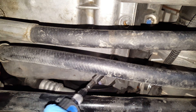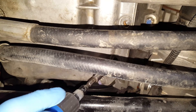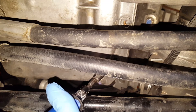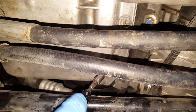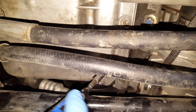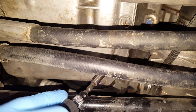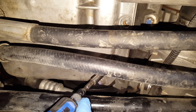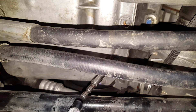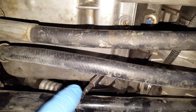We'll see if it's gonna work or if I have to drill it more. Just keep turning. You gotta go really easy — don't rush this. If you strip the extractor out, you don't want that to happen. You can't rush, you gotta go real easy. You can't use a screw gun on this. Just keep turning — see the way it works.